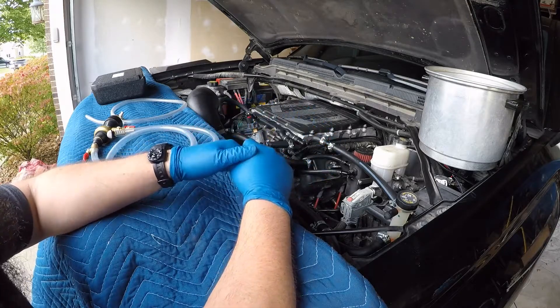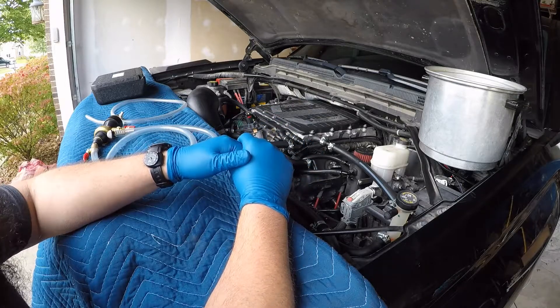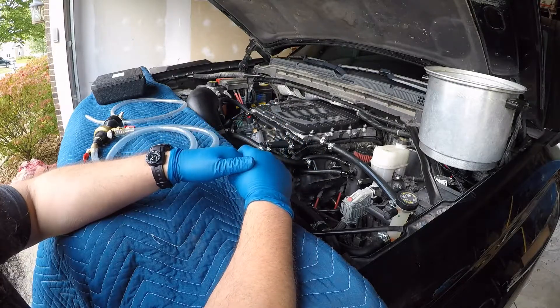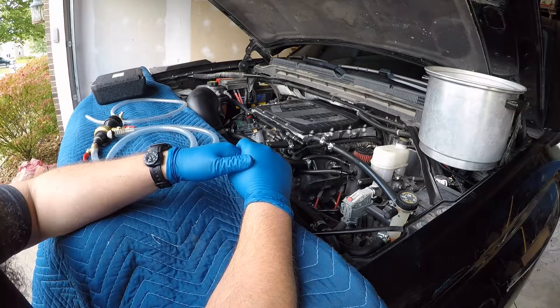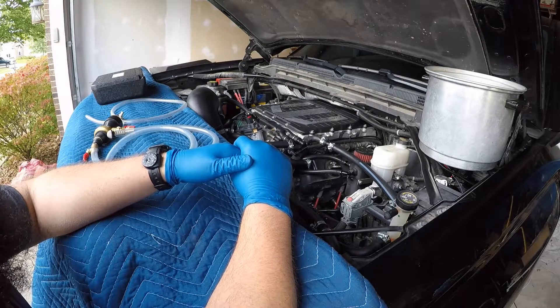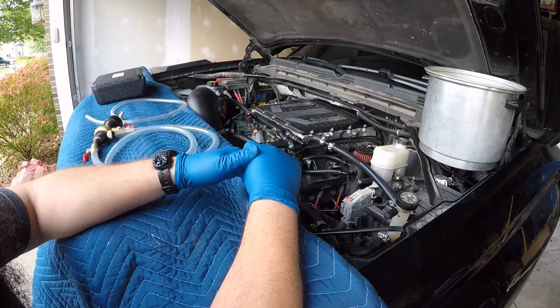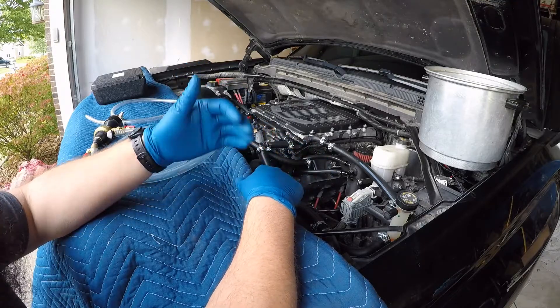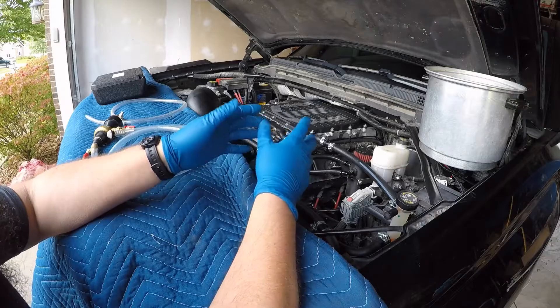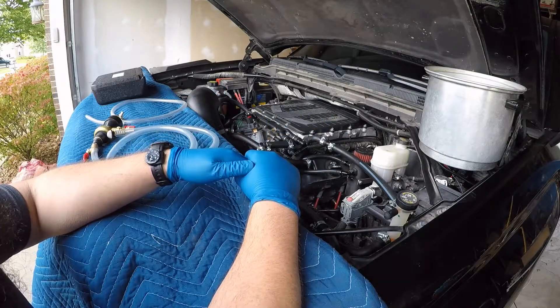Knowing that expectation, I'm fine. But once I start to see temperatures go above 130 — yesterday I was starting to see a climb to 140, 150, 160 — that's pretty darn hot for intake air and charge temperatures. I knew there was a problem going on, and the first thing that came to mind was this pump. So I pulled off on the side of the road in a safe area, opened up the hood, and sure enough, noticed the pump was, again, off.